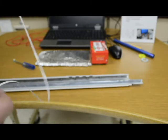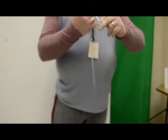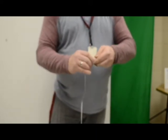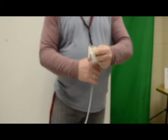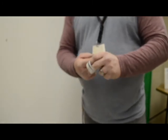Now these cables are very sensitive — be very careful with them. This concludes the video. If you do need to save these, carefully wind them, and I typically run a piece of paper between it so that the tape doesn't stay on it. You can use masking tape, but the nice thing about the paper in place is it will hold it without marring the ribbon. Again, thanks for watching. I hope this was informational for you on how to replace cameras and other parts of the smart board. Have a great rest of the day.